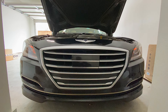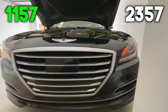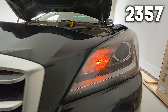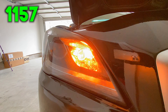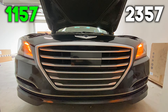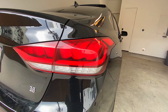For demonstration purposes, I have the 2357 on the right of the screen and the 1157 on the left. To be candid, you really can't tell the 25% difference between these two brightnesses. So despite being a quote unquote dimmer bulb, in real life testing you really can't tell the difference at all. I will take this 1157 bulb any time of the day to make sure it lasts longer and I'm not changing this bulb out every single year. And just for reference, the hyper flashing has definitely stopped once I installed the 1157 bulb.